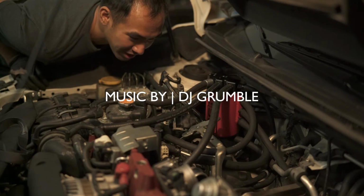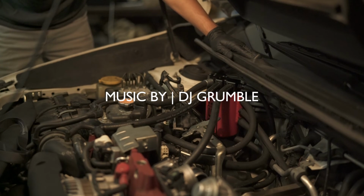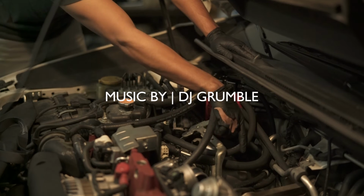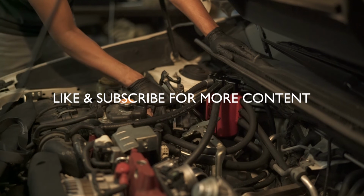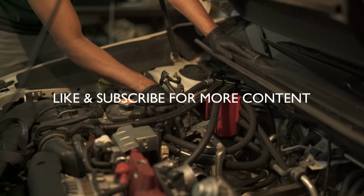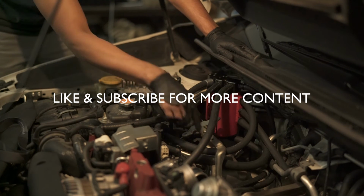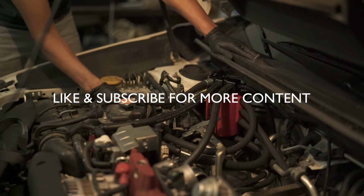IAG air oil separator is finally installed. A couple of things I didn't show on camera. The top hose right over here, how I originally had it routed, went underneath the intercooler bracket on this side, and it was actually touching the, I forgot what this thing is called, the internal wastegate of the turbocharger. So I didn't want that to interfere with any of the pins or moving valves. So I moved this around, up and over the intercooler bracket,